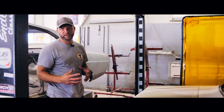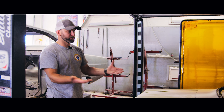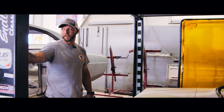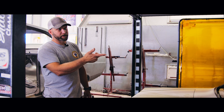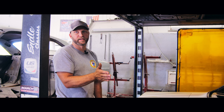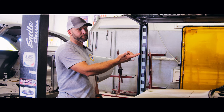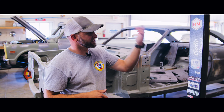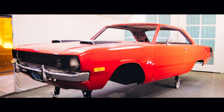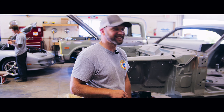We mapped out what we got to do to plumb it and wire it, and now we know where to set everything in the engine bay — that gives us direction of where the firewall placement's going to go, and all the aprons tying back into it. We did get a set of tires in for it, so we're going to shove a 225/45 up front. We're just waiting for one more tool to get our backspacing correct so when the guy's driving the car he doesn't run into the frame rail or the fender. Once we get that, we can get the correct room for the front of the car. We got the Dart for sale in the paint booth right now — want to buy a '72 Dart? We'll build it for you, we got all the pieces here to build a badass little restomod out of that one too. Give us a call: 608-834-5774.